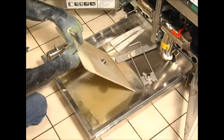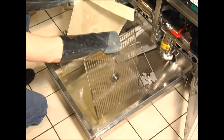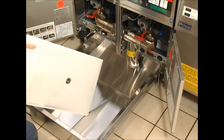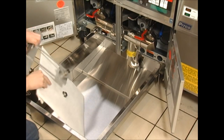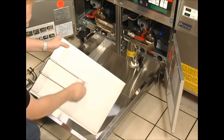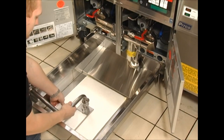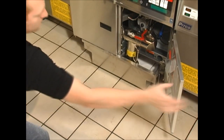Open the paper envelope and remove the support rack. After cleaning the pan and filter components, slide the support rack into a new filter envelope. Attach the paper retaining clip and tighten the lock nut. Place the assembly into the filter pan. Install the pickup tube and swing it down onto the filter assembly. Make sure the tube is seated completely over the collar of the filter assembly.